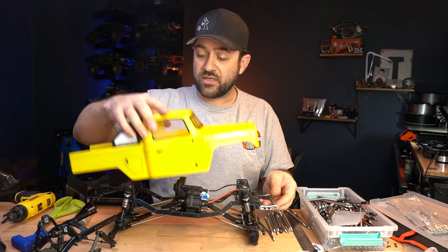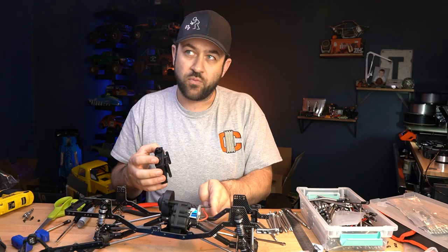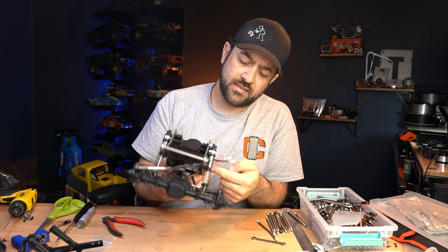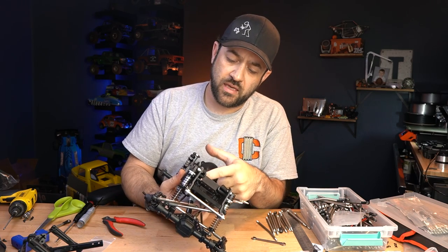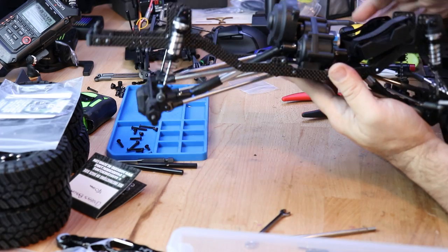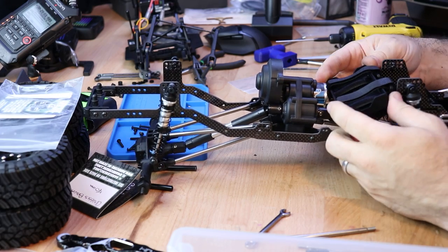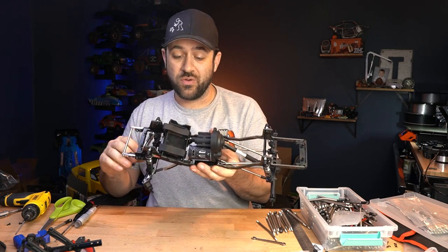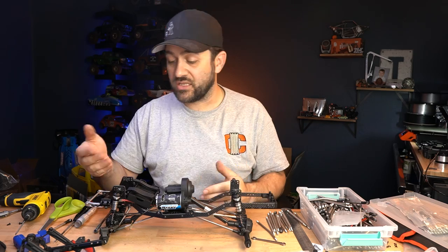Let's take a look at battery tray and electronics positioning. Factory battery tray out — I've got the factory cross member still on there. I just want to see how close it lines up with the bolt holes in this chassis. The skid plate geometry is much different and changes the height of the transmission, causing interference with the drive shaft. I've got the forward-most screws in place, and the chassis screws retightened to get everything back into place. The only problem now is that the battery tray is kind of floating. If you don't have a 3D printer, it would do — at least it gives us an idea of where it needs to sit.